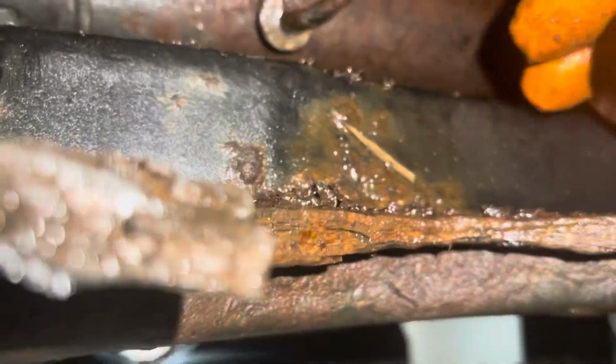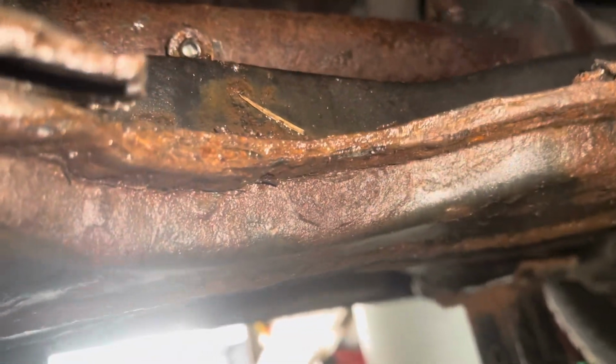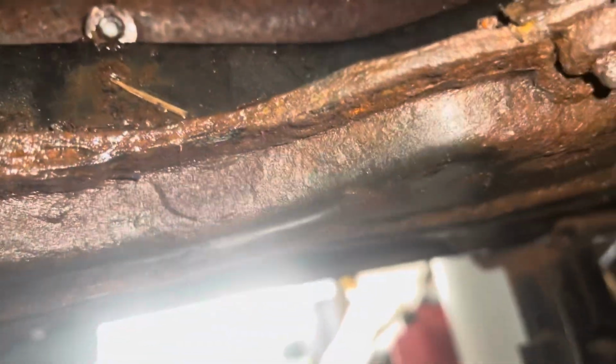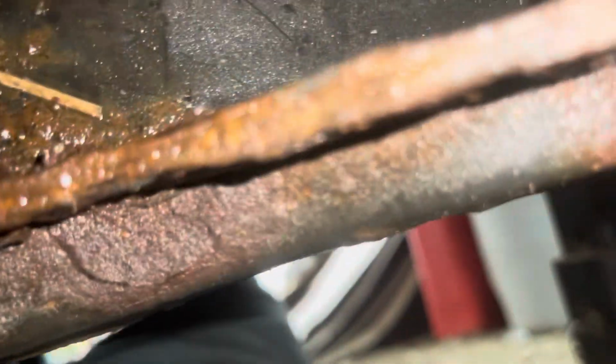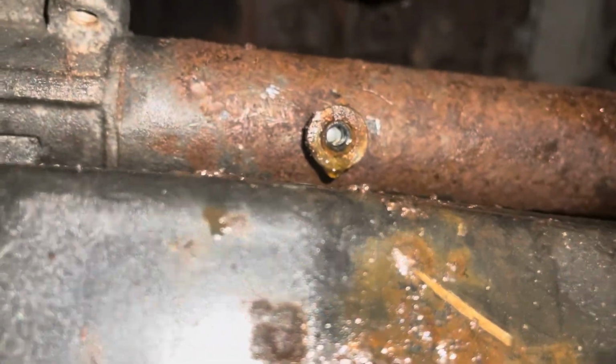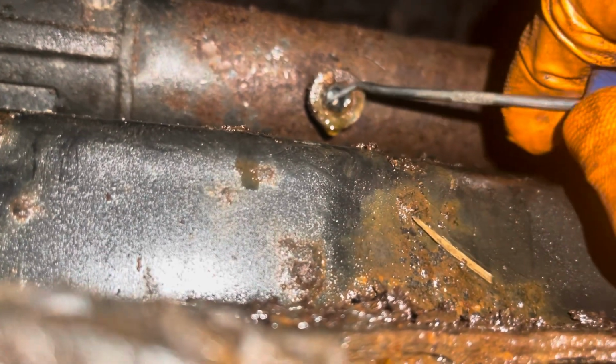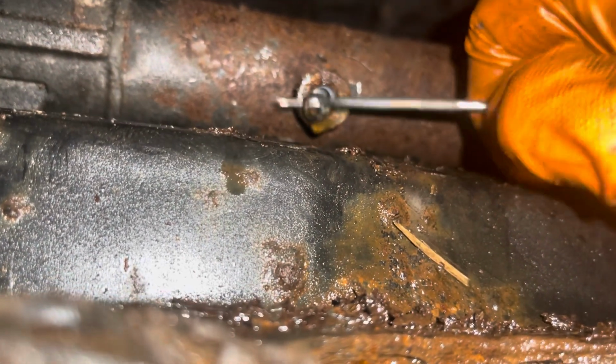That was hard fought. Okay, if we pull that out, we'll drain all the fluid out of the rack right on my chest. There we go. There it comes, perfect. There's the end of it. Throw it over there where I'll lose it for sure. We're gonna get a pick tool somewhere here. Yep, I've gotta have one, the one that's not stuck in my hip. Let's go ahead and fish that seal out of there like that.